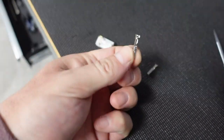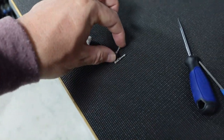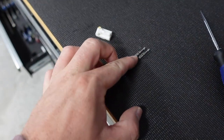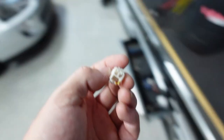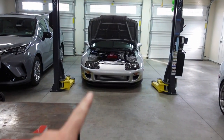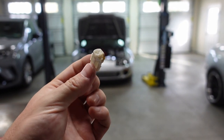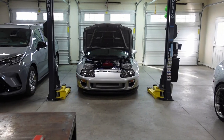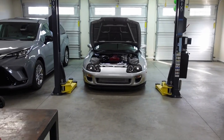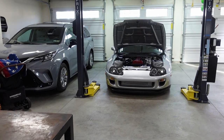I went ahead and de-pinned this. The reason I de-pin rather than cut is Jose Valia at Kaizen Motorsports helped me figure out Toyota pin part numbers. I don't like cutting wires because if I need to go back to factory stuff, the pins are just sitting there and I've got this video showing where they need to go. For now I'm just going to pin it in and flip-flop to figure out which is ground and which isn't. This should be a momentary switch — it shouldn't matter. One goes to ground, one goes to the ECU.